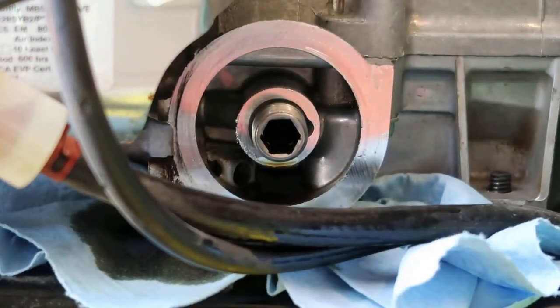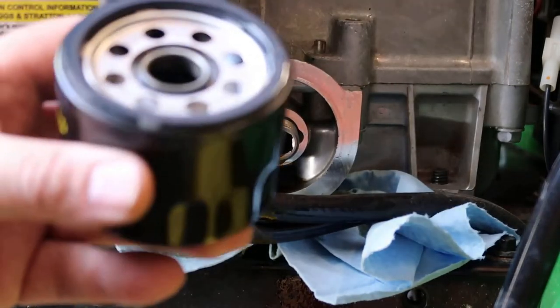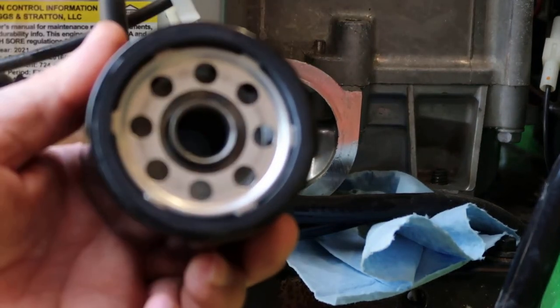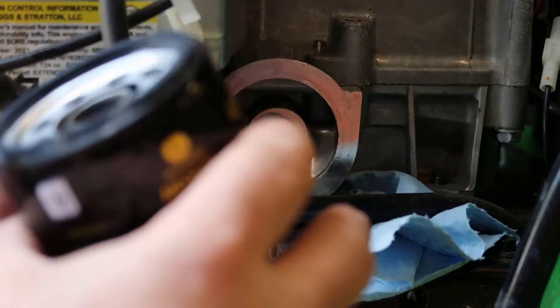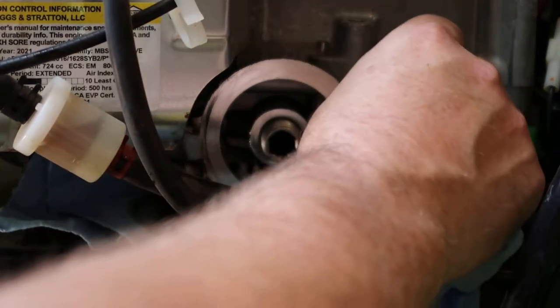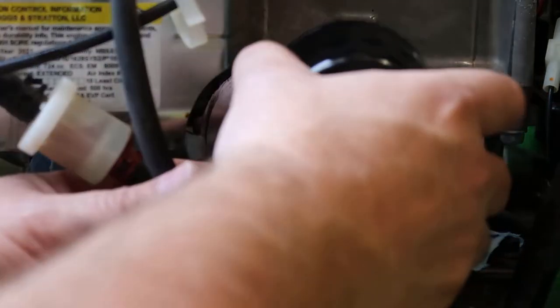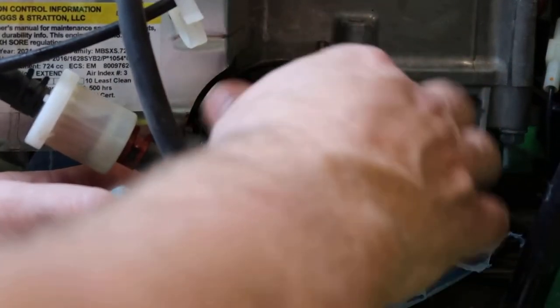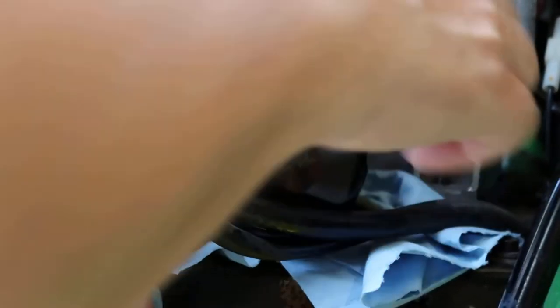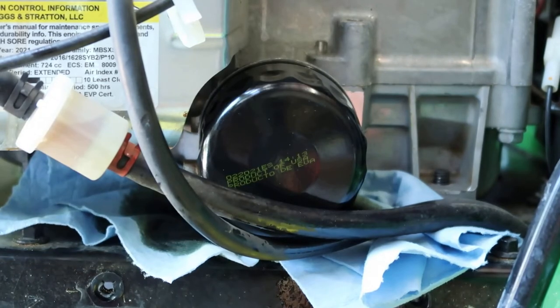Now I'm ready to install my oil filter. Ready to put my oil filter on. Like all my oil filters, I just put some engine oil on my O-ring, and also on my metal threads here — I always put oil on that too, just to lube that up. A lot of people may want to pre-fill their oil filter before they put the filter on, but I don't ever do that myself. I want to make sure all the oil that goes through is actually being filtered. So I just put my oil filter on without any oil in it. Y'all do what y'all want to do on that. There it is — oil filter is on. So this side is done.